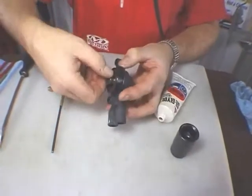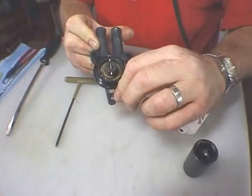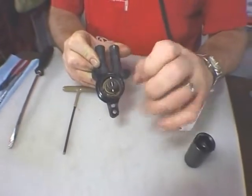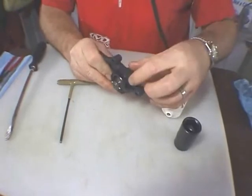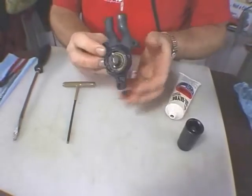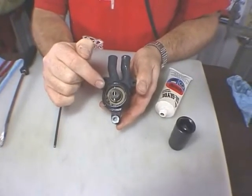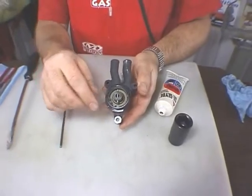Once again we will test and we have nice smooth movement. I prefer to align the pin with the bottom water pump mounting hole and then align the crankshaft of the engine the same way so that when I reinstall the water pump these components align. You may find that if you remove the small o-ring and make an initial test fit of the pump to the engine to be certain that everything is falling into place, then you can carefully remove it, put the o-ring on, and reinstall it — certain that these pins have fallen into their position on the drive of the crank. You should not attempt to force this component onto the engine; if you have resistance, double check your work to make sure all pieces are properly aligned.